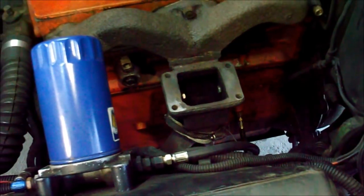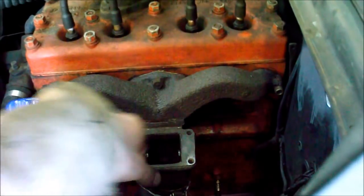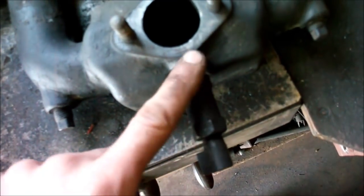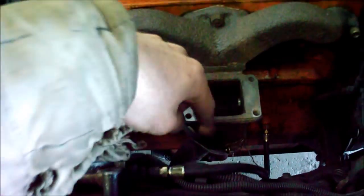I'll bring you back when I've got more progress on the intake. I just need to make two flanges for the head and the block and then another one for the carburetor, then find some pipes to connect it all. I'm still going to use the old PCV system - that's important because when I first had the Jeep for quite a few years it was milking up the oil. I redid the PCV system - it pulls the fumes out of the block into the intake, and that works good.